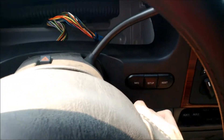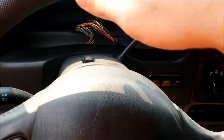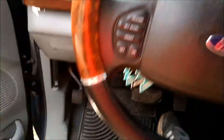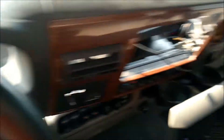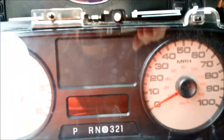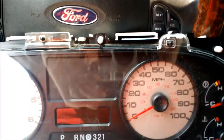What we're going to do is put our key in. You want to make sure you're turning into the on position and that your steering wheel is all the way down. Then we're going to set the e-brake — it's already set. Step on your brake and then pull this all the way down into the one position. That way we can pull it all the way out — it pulls forward, pulls out from your stereo unit, and allows us to fit the cluster back in. Circuit Board Medics cleaned it up and the cluster should be good once we plug it all in, but we're going to do a test.